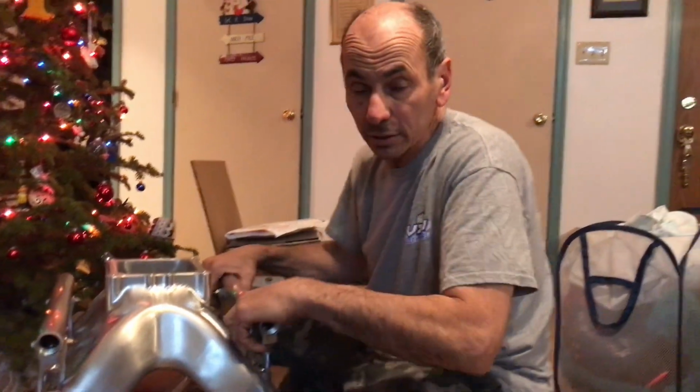So what I might do now is, it's a 427 cubic inch. The rods and the crank will go right in that block. I'll bore it to 125. I'll use those pistons on the aluminum rods with the crank. I already have everything else, and then just put the same heads and everything back on the motor. And instead of being 363 cubic inch, it'll be 427 cubic inch, plus the fixing of the compression and everything else. So we're probably going to end up doing that, one or the other, instead of selling the block and everything else.